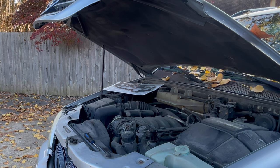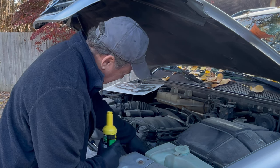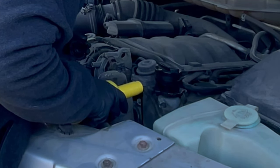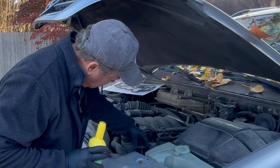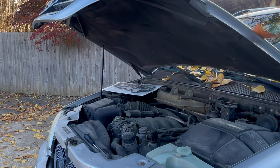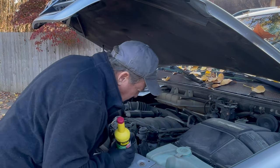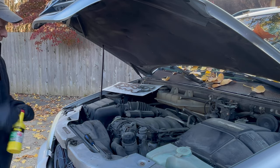That's the whine. I don't like the chatter. I really don't like the chatter either. So hopefully we don't have any oil delivery issues. Can you hear it? I can. We definitely have fluid now. Okay. Let's see if we fix something. Well, it's not as loud as it was. Hopefully we'll get all the fluid kind of going through there. I don't see any obvious signs of a power steering leak. It's just this chatter is bad. This chatter is really bad. So, yay! Let's move on to step two.